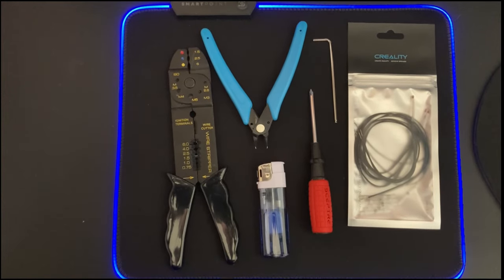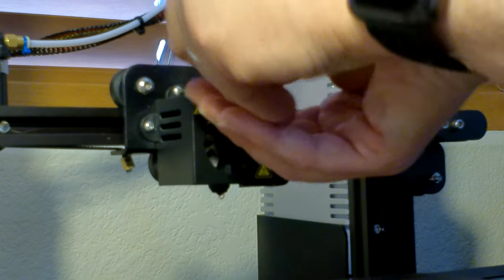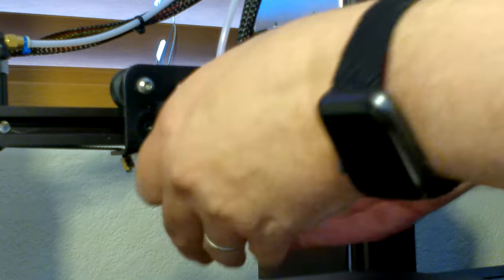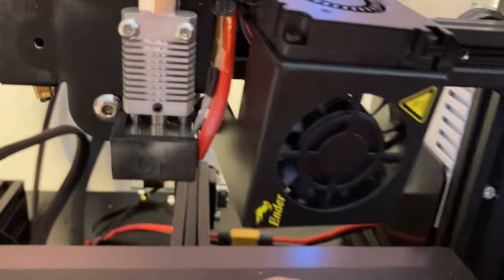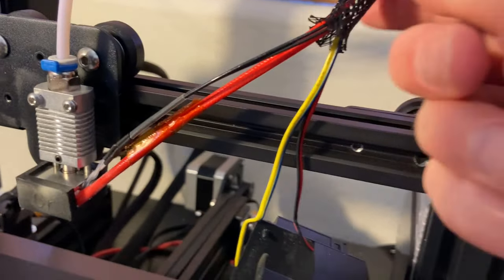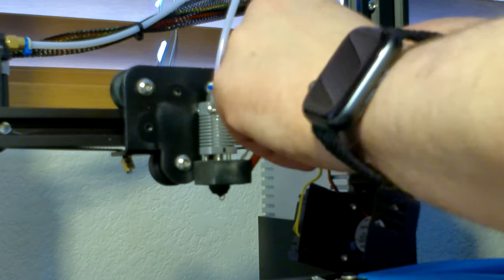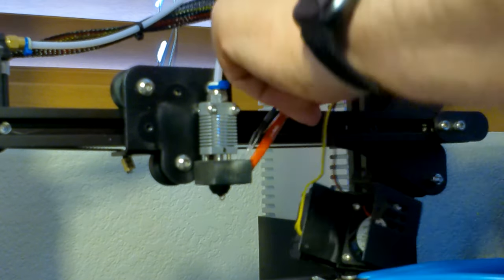So these are the tools that I used for this repair. First, you have to remove the two allen head screws holding the fans onto the heating element nozzle part. Move that aside and you'll see a wire bundle that is taped together with heat resistant tape — that's this yellow tape, this yellow film right here. You want to carefully cut that apart so you can get access to the individual wires. You also want to cut one or two of the small zip ties holding the wire loom together so you can slip it back and have a little more slack to work with.